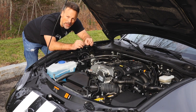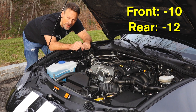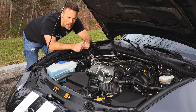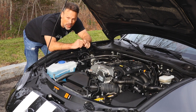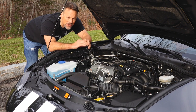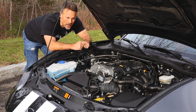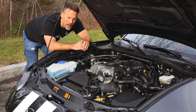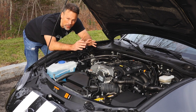You can fine-tune your settings anywhere in between, and that's what I've been doing. I haven't found the perfect setting just yet, but currently I'm using negative 10 on the front and negative 12 on the rear. I started all the way from hard and started making adjustments, making them softer as I go, and I'll probably make them softer still. Negative 10 and negative 12 is almost there — very close. However, here in Massachusetts the roads are really harsh with a lot of broken pavement and it can get jarring. I wouldn't be surprised if I end up at negative 12 or negative 14 on the front, with the rear being a minus two or minus three on top of that.